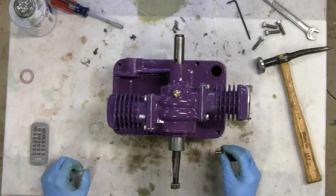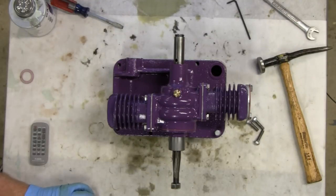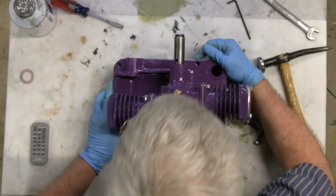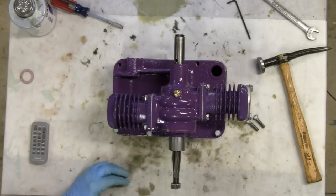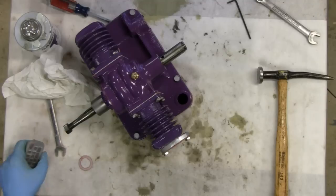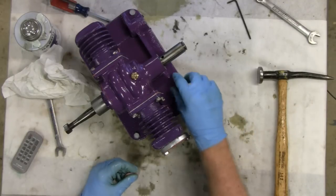There are the bolts here. One of these bolts we don't have to put in right now — I think it's the one right next to the gas filler. We don't have to put this in because that holds your clutch cover. I tightened all the bolts down. This one I put in, but like I said, it's going to have to come out because that's where the clutch cover goes. That's only in hand tight.